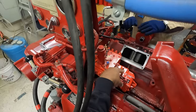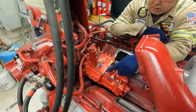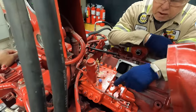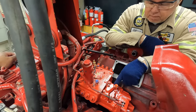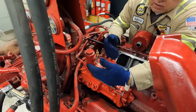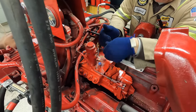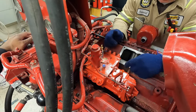So what's this body right here called? Underneath this timing pin you can take these bolts off — that's your rack setting. It's got a little rod that goes down into the control rack, so you've got two rods that run across it. The sleeve metering controls the fuel for each cylinder, for each injector.